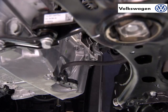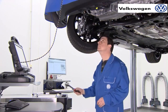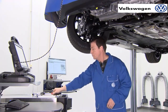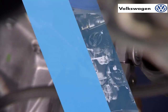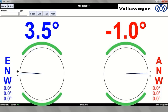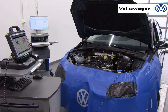Remove the securing bolt and rotate the crankshaft by about two turns in the direction of engine rotation. Screw in the securing bolt again and reposition the first cylinder in the top dead center. The measured values will appear on the display. The nominal values are listed in the current workshop manual for checking. In this case, the values are not within the set value range — the valve timing must be adjusted.